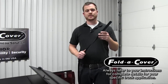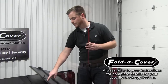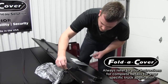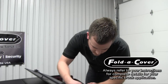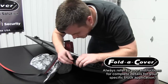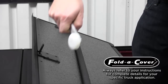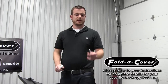The final step in the installation process is to install the weather seal. Before proceeding, we recommend you clean the contact surface with an isopropyl or denatured alcohol. Once the contact surface is cleaned, apply the adhesion promoter that has been supplied to you. Once your adhesion promoter has been applied, it's time to attach your weather seal. The adhesive on the weather seal is pressure sensitive. We recommend that you use a pressure roller or a wet out tool such as this to apply firm pressure. If one is not available to you, an alternative method is to use the box end of a wrench.